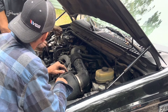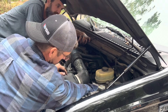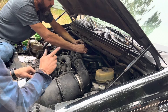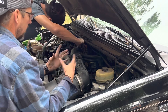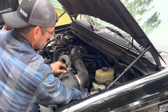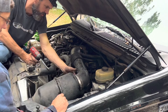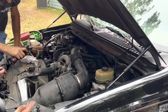Does your cruise control work? It does. This thing has really been well maintained — it's had the recall done. The recall? Yeah, for the cruise control. See this brake sensor here? The diaphragm between the brake fluid sensor would rupture, and it would let brake fluid in there and cause it to catch fire and burn the whole car down. And if it was in your garage, it'd burn your house down too. So that's why they issued this recall — there are fuses in there now. So if it ever goes out, check your fuses. There are two of them for the cruise control.